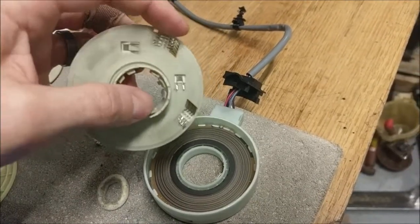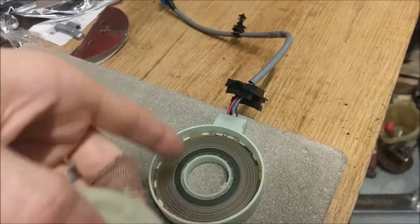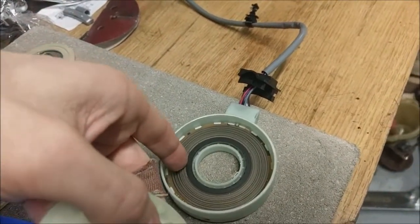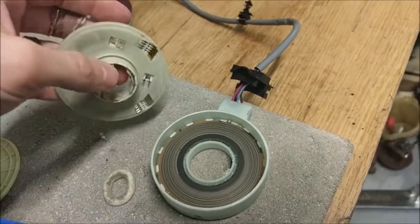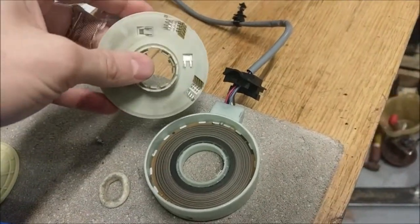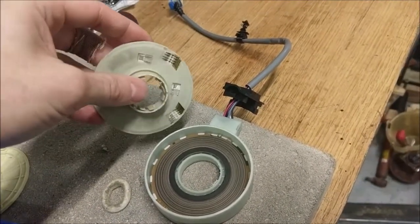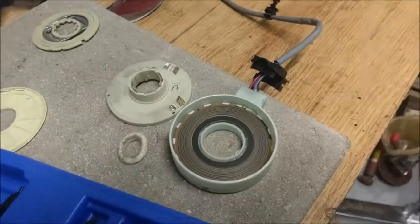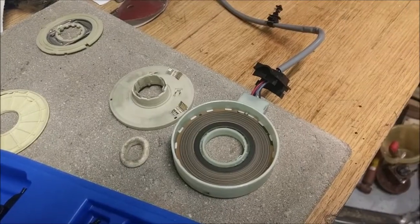All that black dirt — obviously if it gets moist there's going to be dirt down here too, or carbon runoff, whatever you want to call it — gets scraped off and the dust collects. When that gets moist and the wiper comes around, it all collects on the wiper and your signal just goes terribly bad. That's why after going through the car wash and condensation got over everything, this sensor just went on the fritz. Always put your car in recirculation mode before going through car washes in wintertime when the inside is really cold.